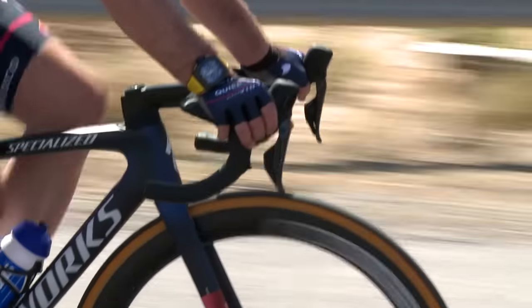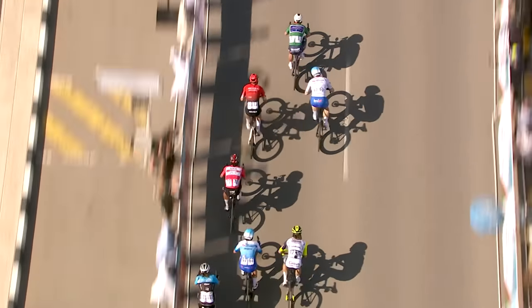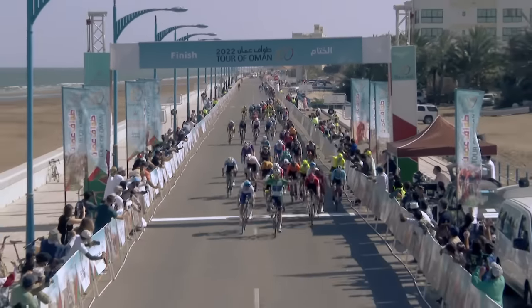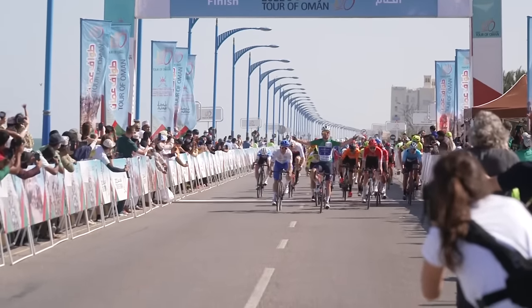Yes, absolutely. So what I was talking about earlier with the initiation of damage at a low level, that will propagate. And the higher the loads and the higher the number of cycles, the greater that damage accumulation will be. And certainly if you're looking at someone like Mark Cavendish, then the power output that he's putting through that frame, and it's reacted through the bars. So it's not just through the pedals, but the whole frame is reacting that load torsionally through the bars. He's putting an awful lot of load through that frame, and he's doing it again and again.